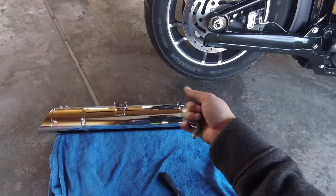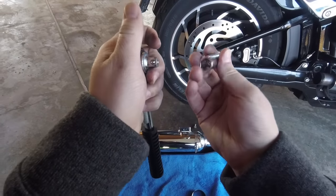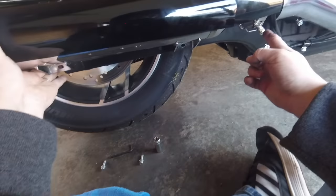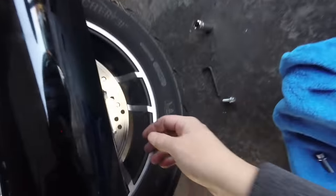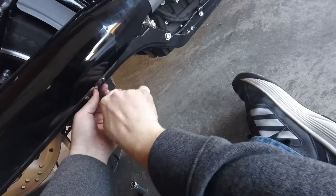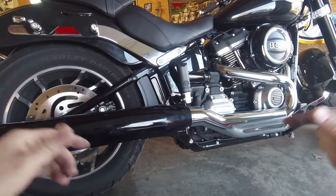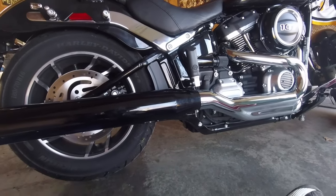Once they're all tightened up, we're going to put the clamp onto the head here, then we'll get it bolted on. This is where you're going to use your 7/16ths hex bit socket on your ratchet. Before I tighten here, I'm going to put the two bolts in loosely by hand — get those holes lined up. We're going to reuse the stock hardware. Take your socket and tighten it down, then go under here and tighten these up really well too. There are torque specs for all of this — I'll put them in the description below.